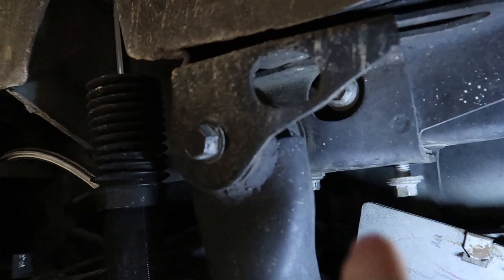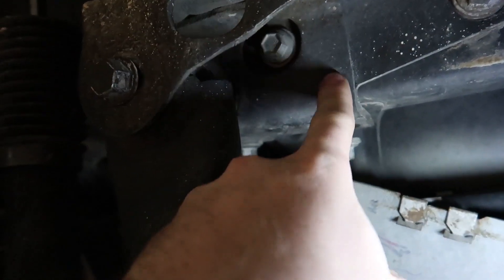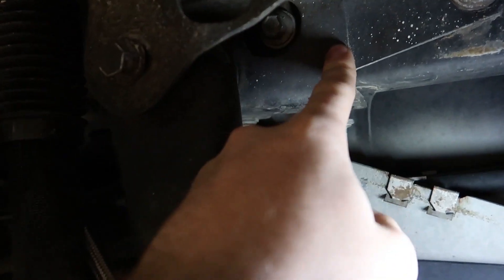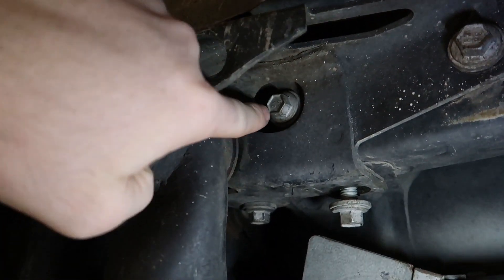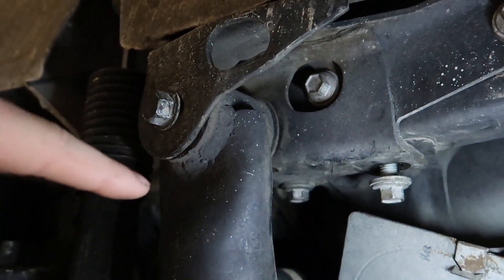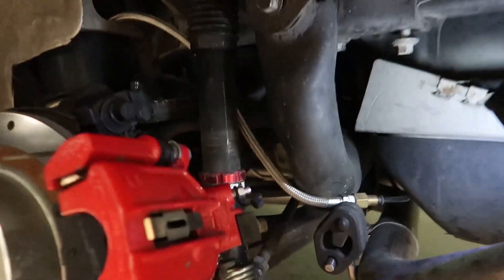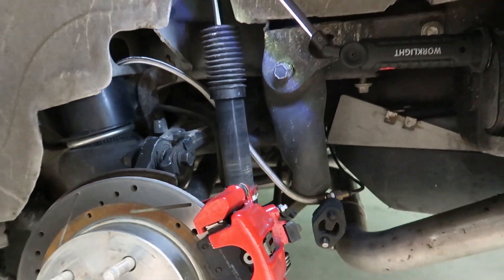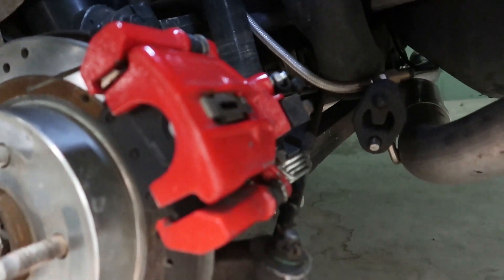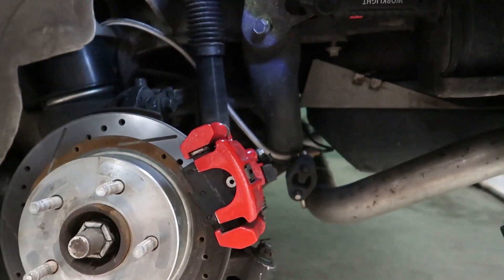We're gonna come in here to the wheel well — there's this bracket. This is the bracket I was talking about; there's one on each side in the same spot. You are going to need this bracket. Make sure if you buy an IRS system, they have this bracket. It mounts here, it mounts here, and it mounts through these two bolts here, then it comes up and over, and your IRS actually mounts right here. There's one bolt holding that up on either side — four mount points total to hold this whole system. Subtracting the struts being mounted, plus the driveshaft connected — that's that simple.